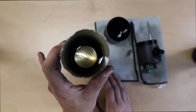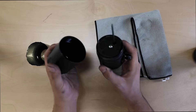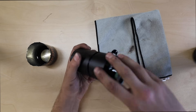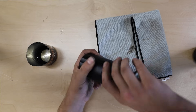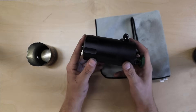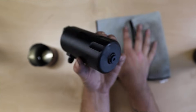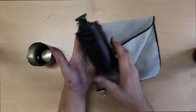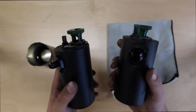I'd estimate maybe two tablespoons worth of oil caught in 4,000 miles — which is a pretty good result. Both air oil separators and catch cans use baffling; one is just more complex to return oil and air back into the system, while catch cans retain the oil until you empty them. Some catch cans do give you the option to add a drain port on the bottom if you want to plumb it back into the system or drain to a separate reservoir.